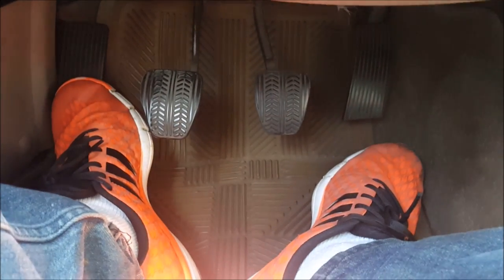And then you have your little resting foot pedal over there. As you're moving, you don't want to leave your foot on the clutch — don't even put it on top of it or rest it on it. Just leave it over there, don't touch it, because then you'll prematurely wear out your clutch and some other components. So: brake, gas, clutch — it's that simple.